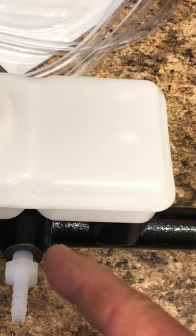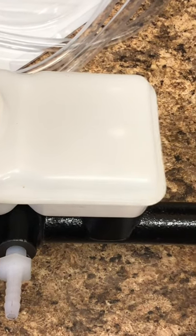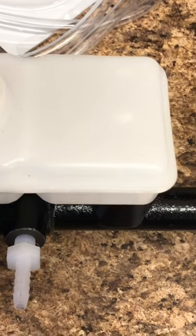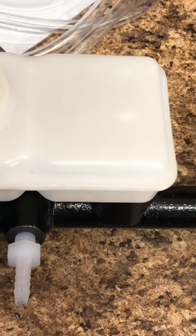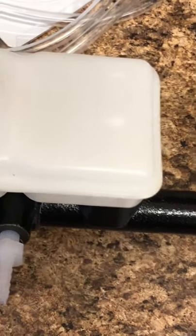The next step is I'm gonna move this downstairs to my vise, put it in a bench vise, and then fill it with fluid and pump it to fill the reservoir and fill the chambers in the master cylinder and bleed it as much as I can prior to installation.